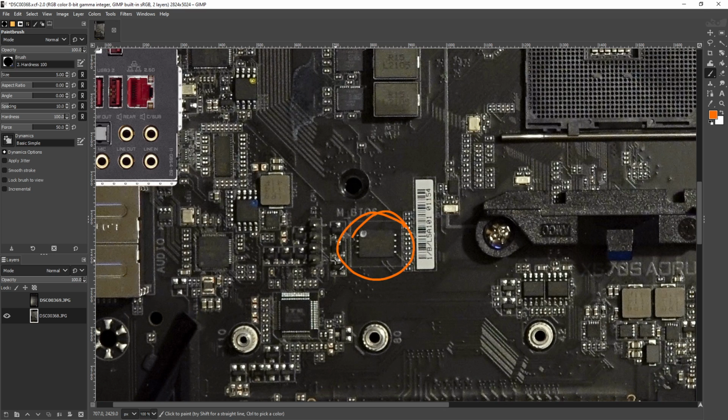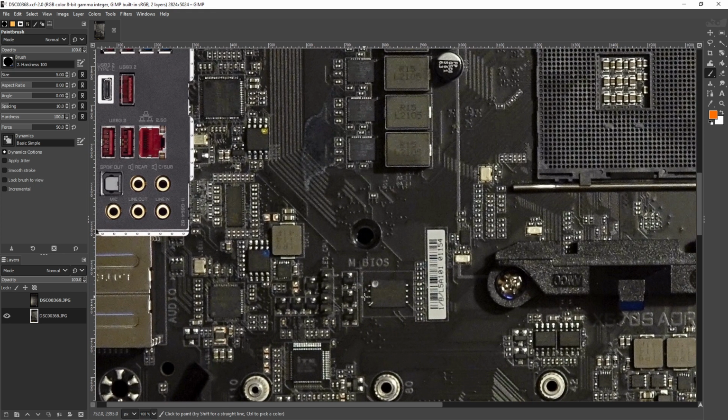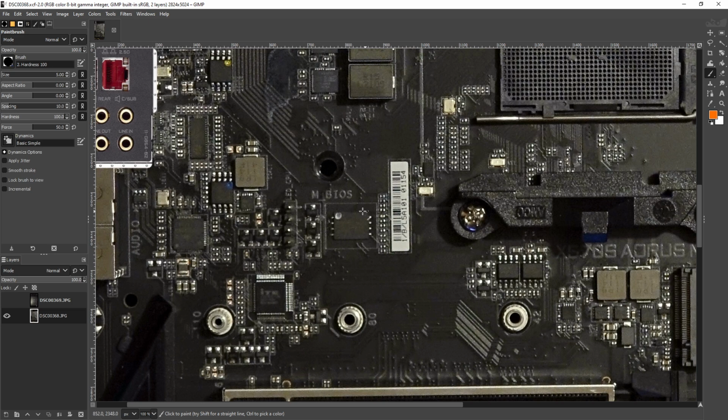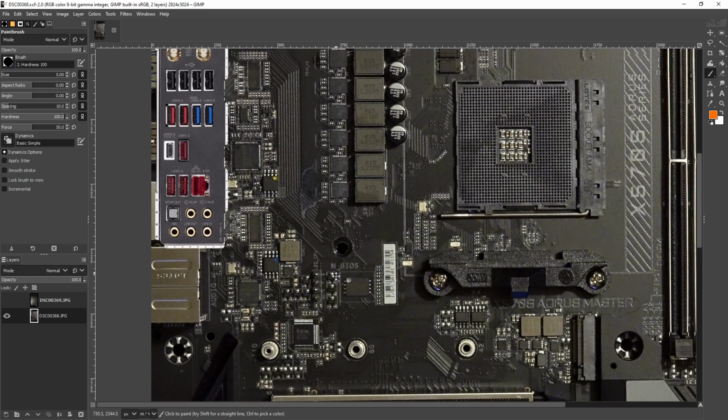And yeah, that's a bit unfortunate as far as I'm concerned, because I really like having dual BIOS for testing different BIOS versions, especially with how AMD likes to break the AGESA every so often. Having the ability to just put the new update onto the other BIOS chip and then find out that it's terrible and go back to your main BIOS again is really cool. You can't do that on this board because Gigabyte, I guess, has given up on trying to explain to people that they should disable the automatic dual BIOS.